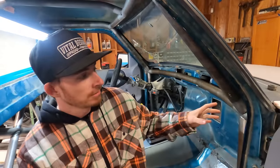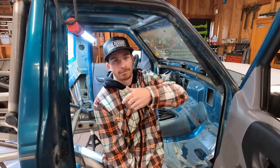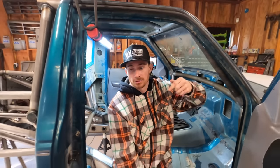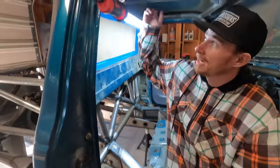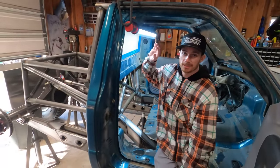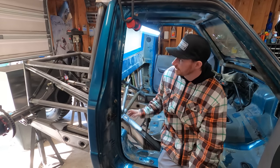So you started going on the cage on the inside. You still need to add some stringer tubes on top — all I needed was just the main structure in here to be able to get the tubes out of the truck so I could start on the back wall. The reason the stringer tubes in the ceiling aren't in yet is because I was waiting for him to get seats, which we'll show in this video. I was waiting to make sure there was enough head clearance, since we were kind of worried about these pivot boxes being as high as they are in the truck pushing the seat up too high.